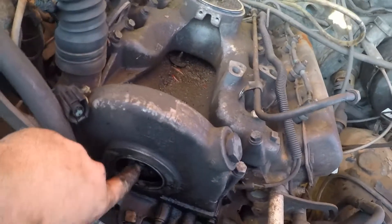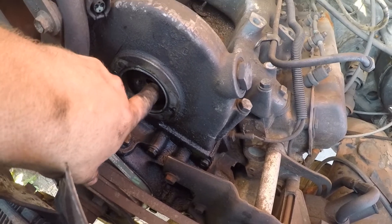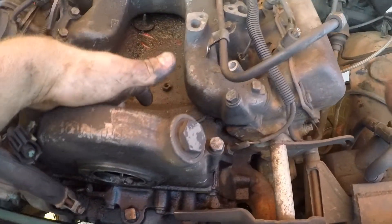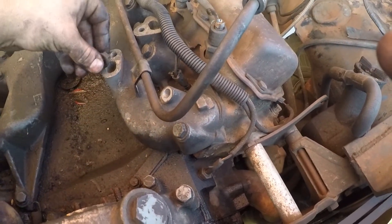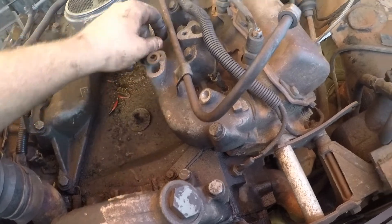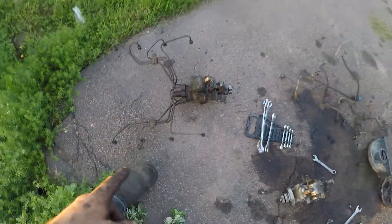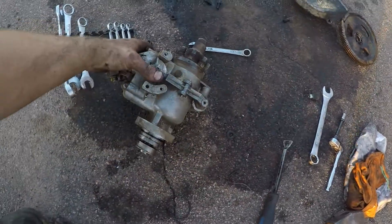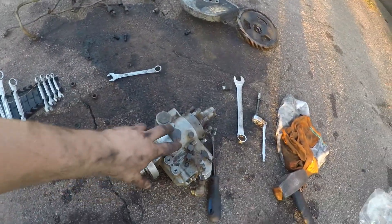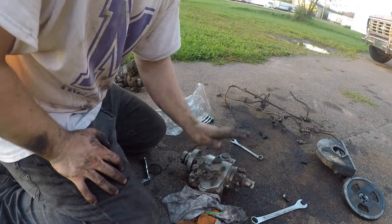Here's a good chance to look at everything. There's our timing gear — it can move around a little bit but it's pretty much locked in. You don't really have to worry about anything getting dislodged. The alignment pins are still in there. There's a pin here and a pin at the back. We'll clean up a little junk at the bottom of the valley pan before we put the new pump in. Here are our two pumps — the original one out of the truck and our replacement. It's a used but known-good pump, exact same part number, turned up the same.